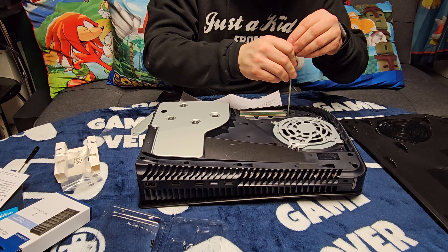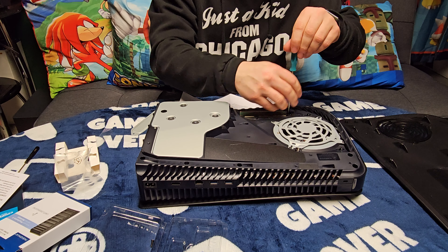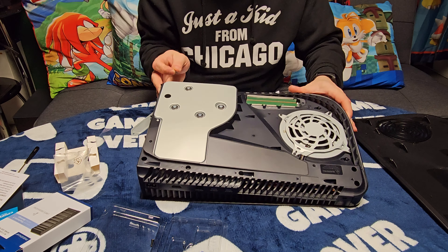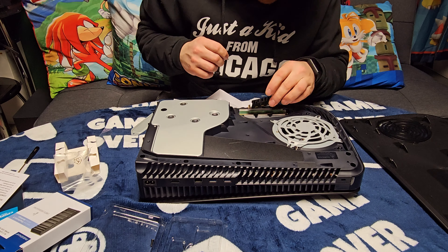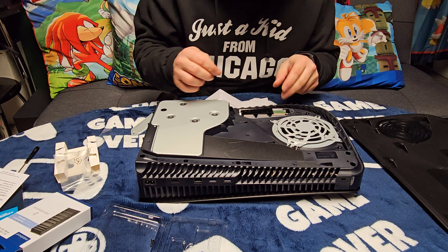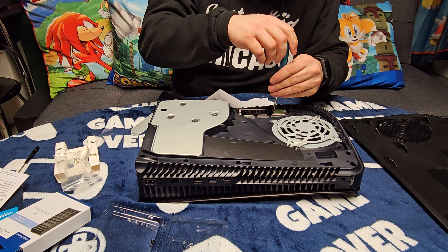So the side with the elongated holes goes this way, and the SSD sticks out of there. I put it like this, then place the top cover on the M.2 SSD, lining up the holes — this is how it's looking. It says use the included screwdriver and four small screws to secure both sides of the heat sink. Let's screw them in. Alright, got a couple screws left and we're done with that.